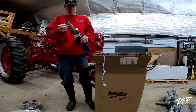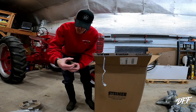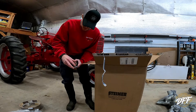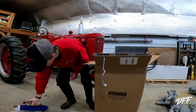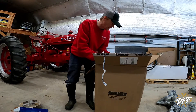This is just some general cork material — a roll. So if I had an oddball gasket or something that needed to be repaired, I can just trace and cut out my own. I don't necessarily have to order a specific gasket. I just bought that for general gasket use.